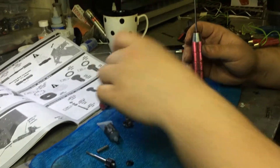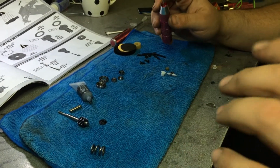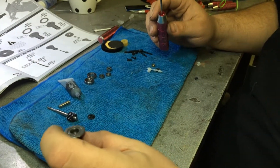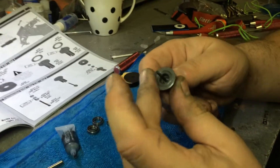These outputs are usually pretty sensitive to which way they go on, so that when the car is driving your diff's not loosening — that's a mistake a lot of people make. You've got to make sure that when your car is going forward it's tightening the screw, so that it doesn't come loose on you and become notchy. In our book here it tells us to put it in this way, with the screw on the female end of the cup. So now we've got it installed.